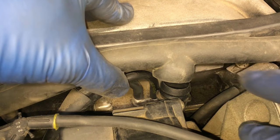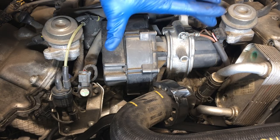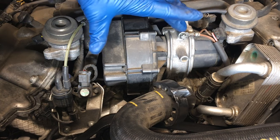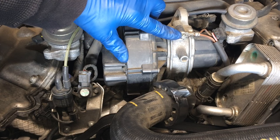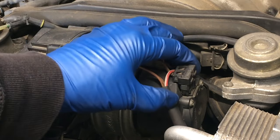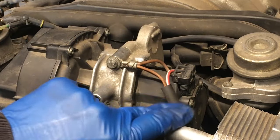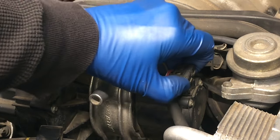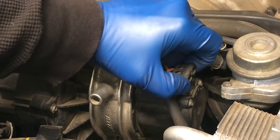This component here is a secondary air pump and it's in our way, so we're going to remove it. It's very easy — we just have to lift this air hose up, remove this E10 fastener, and disconnect the electrical. Here's the electrical for the secondary air pump on the side: there's just two little clasps. Push in there where there are those little marks for our fingers and give it a wiggle and pull it up. There are two prongs — give it a little persuasion.